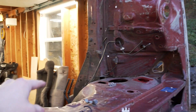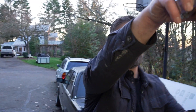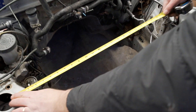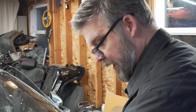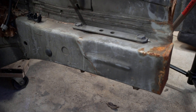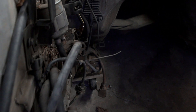That means the frame rails of that car are probably bent all the way back to here, which is the part we want to keep. Get a shot from this side so you can see this frame rail — there are some buckles we can show. On the front clip it was 34 inches on the dot, and this is exactly a half inch off. So this is moved, or both of them are moved inward toward each other, a half inch. This is not something I would expect to be off on a production line — this would be exact on every car. See how buckled that is? That's straight on the other frame. So that's evidence that there's problems here. This side looks much straighter, pretty damn straight from what I've seen.